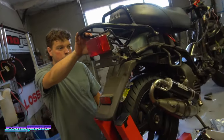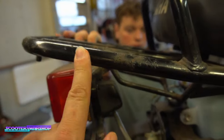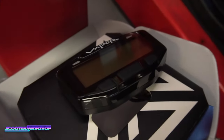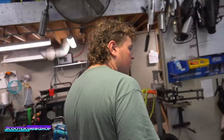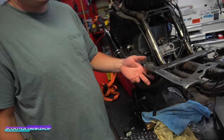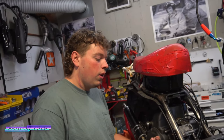This one looks the best of both of them, but it's still definitely rusty. They're both getting Vapors of course. We got some frame repairs to do on this one — it's just broken. It's not super structural, but your floorboard goes on there and your feet go there, so we're just going to weld it up, cut this off, and weld the nut under there so we can bolt all the fairings on.